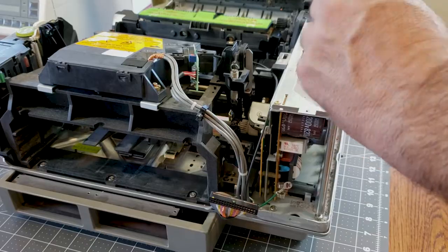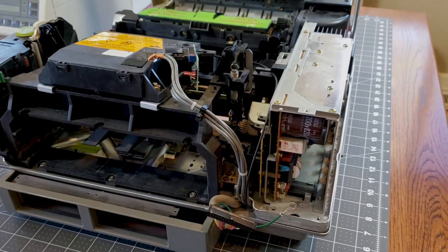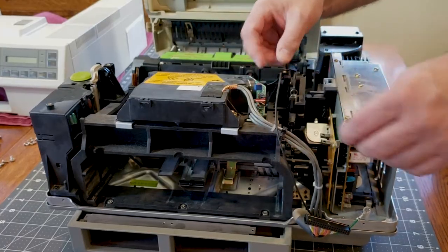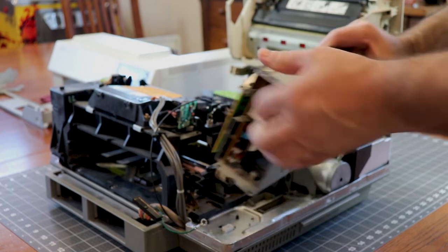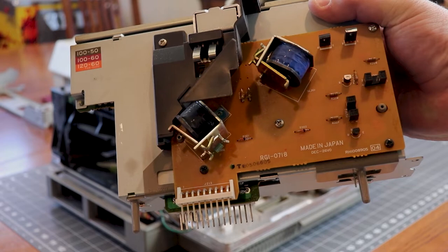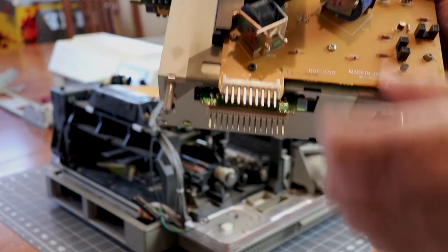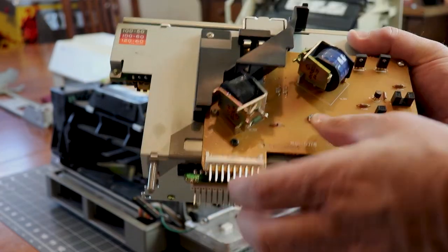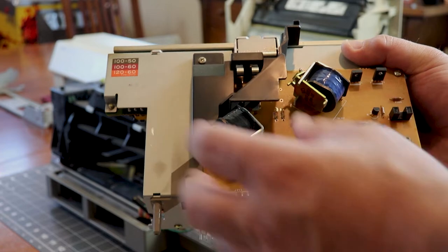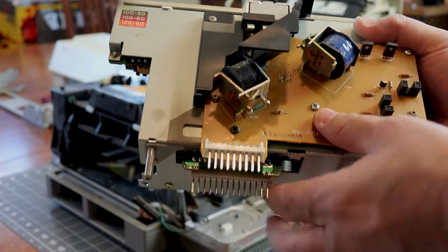Next I'll remove the DC power supply. It has three screws, one of which has a star washer to ensure a proper ground. I'll also disconnect the main motor and release the fiber optics cable from its guide before removing the power supply by pulling it straight up while gently rocking. Attached to the DC power supply is the paper control PCA. These solenoids are what release the feed rollers and allow paper to pass through the machine. As I expected, the foam noise dampeners have broken down and become sticky — depending on how long they are sticking they can cause paper jams, registration issues, or multi-feeding problems.